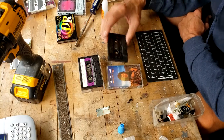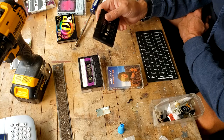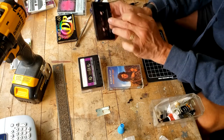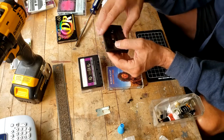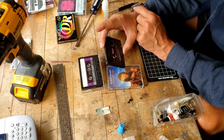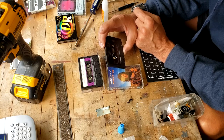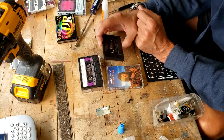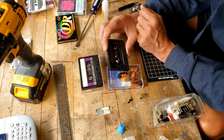Because I like the tape and it's part of my collection, I want to salvage it. Unfortunately this one doesn't have screws on it where you can unscrew and take it apart, then find a donor tape to put inside — which is normally what I'd do. I'd get a nice high-quality chrome tape and make a better recording than it ever was at the factory, since these are high-speed dubbed on normal bias tapes and don't sound as good as they could.